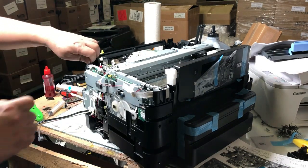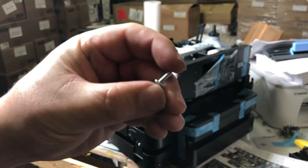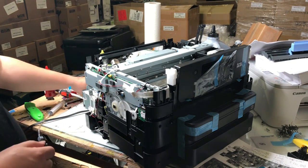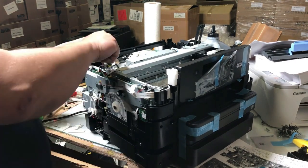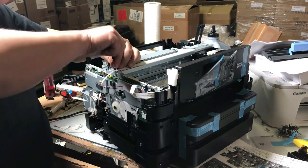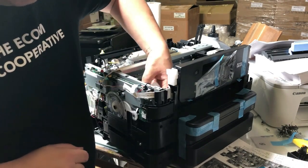With all the wires gone, start unscrewing — one from the top and I think two at the back. Epson uses a larger spiral screw for plastic and a finer machine screw for metal. There's also another screw in the back. Here I'm loosening the power supply a little bit — you'll see there are a bunch of screws for the power supply. Then two more screws, and we're going to take off the printed cable, the FFC cable, from the motherboard. You'll need a really long six-inch number two Phillips screwdriver. Take out the Wi-Fi card — don't forget to put it back.